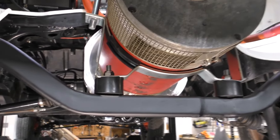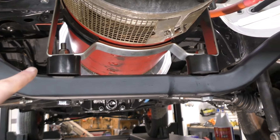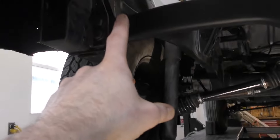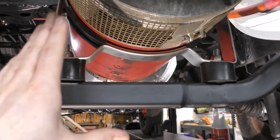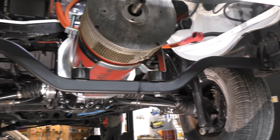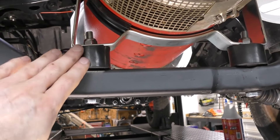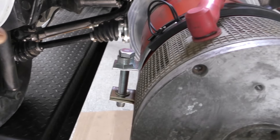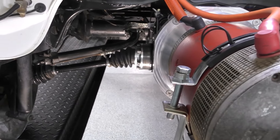There it is — I finished installing it and I think it looks pretty good. I was happy I didn't need any spacers. The bobbins were very tight — I had to use my rubber mallet to push one bolt into alignment. That tight fit means a few pounds of upward pressure on the motor, so it's cradled and well supported. I wanted a little pressure but not excessive upward force. From the top side the bolts are all cinched up. I had to loosen everything to wiggle it all in, but everything is bolted in and looking really good.